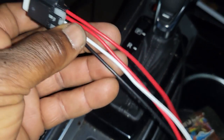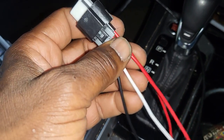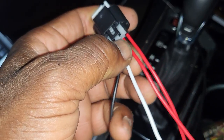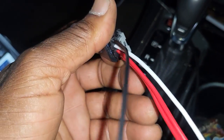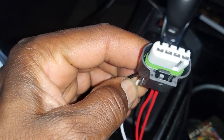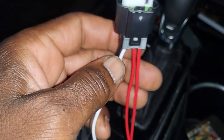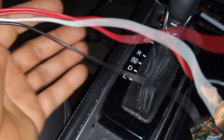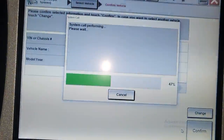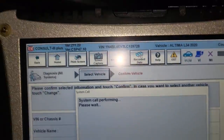I'm going to stop the machine for a little bit. This connector comes with four wires but it's actually three wires. I'm going to put in the three wires - I believe the white or the red one is not available. We're going to look at it, put it in correctly, then come back to clear the codes. If the code clears, good. If not, we know we've fixed this one and then we look for the next issue. The machine is currently at 47 percent.